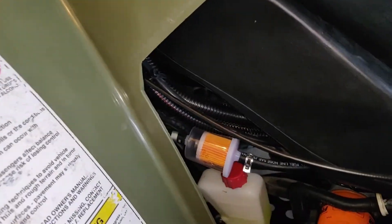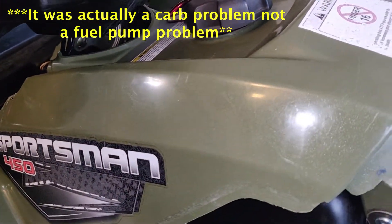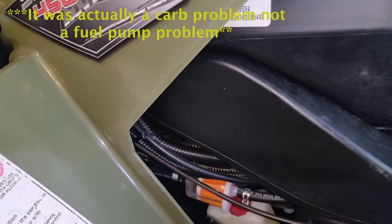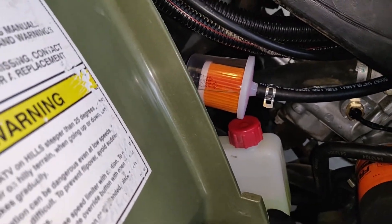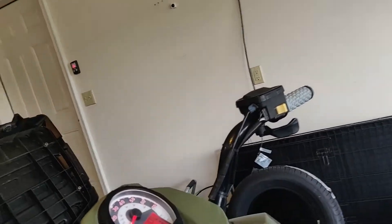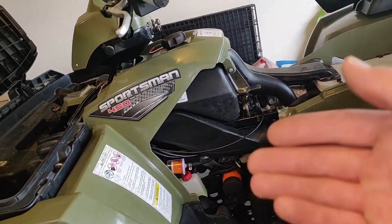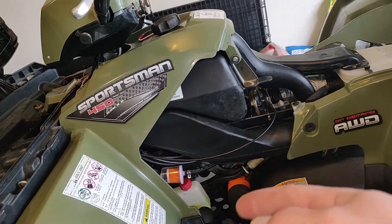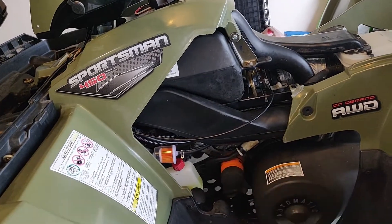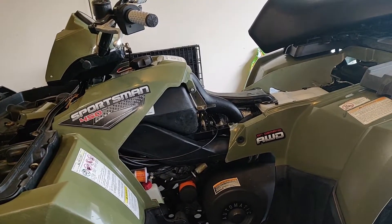It's perfect, it's just what we wanted. I was having issues before giving it gas and it kind of hesitating. So I'm hoping that this helps. We'll see — there could be bad gas in it too, but at least now the fuel pump is connected and we won't have to worry about that anymore. Brand new fuel pump on, should be ready to rip. We're gonna call that good guys. If you guys are gonna change the fuel pump on a 2007 Sportsman 450, that's how you do it. Let me know if you guys have any questions. I got my fuel line at my local AutoZone or O'Reilly's — any auto parts store should have fuel line. I use quarter inch, that's what this ATV takes. Leave a like, leave a comment, subscribe. Thank you for watching, peace.